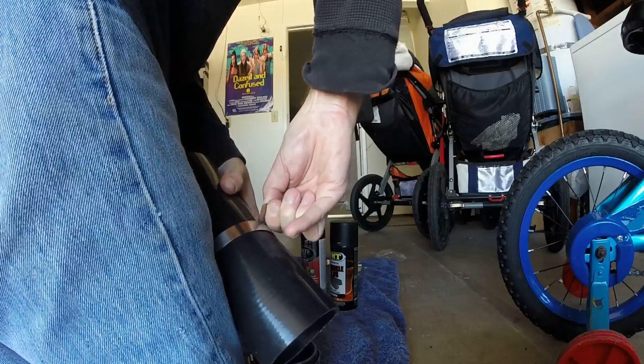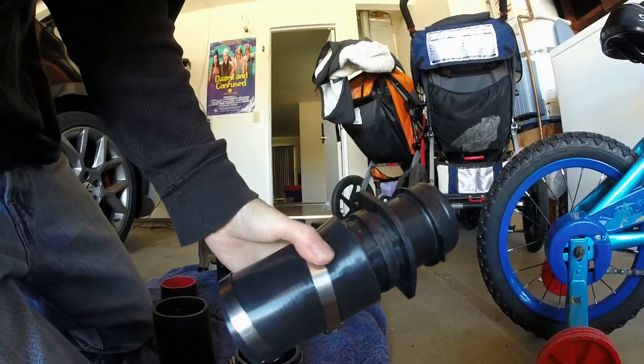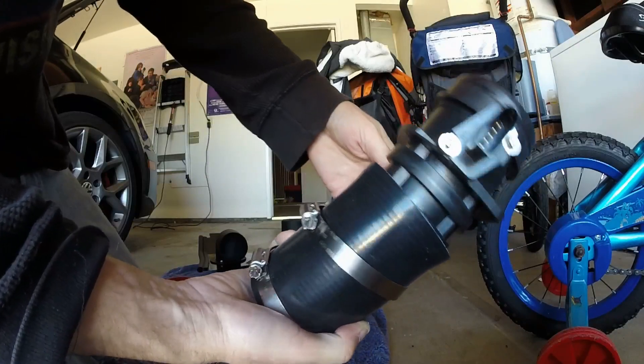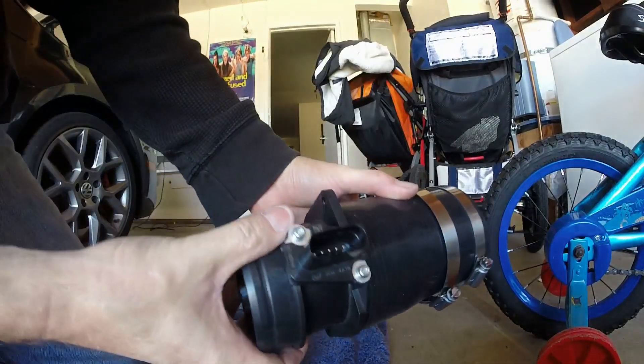Be careful though. Using the hose clamp for a marker like I've shown you before, you want to put your MAF into this hose first. Remember the new speed one was a little bigger, so this three-inch hose is a little tight, but you just got to stretch it and work it through and it'll fit. There we go.